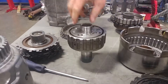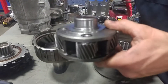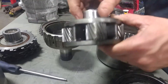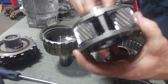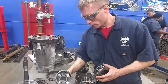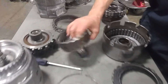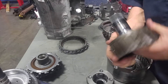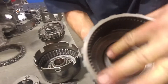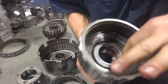The gear assemblies go inside of this. These are another planetary gear set — a little bit reversed. This will be both mounted on the shaft, and this is the connection shaft to the output portion. Carrier assembly — your sun gear would be your output shaft — carrier assembly, your planetary gears, the ring gear is in here. This one has a small little bearing set — there are small little needle bearings in it, so you want to make sure it has free movement.